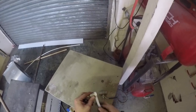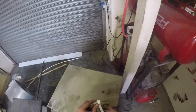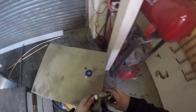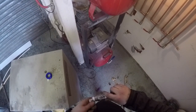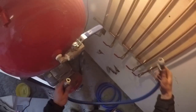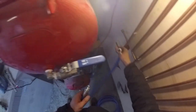Pre-fit and have a think about it before you start tightening everything up, because you might find things are upside down or the wrong way around when you put it on the compressor. I'd do about 10 to 15 wraps of PTFE tape on each of the fittings, and I ended up with not one leak at the end. There was one leak but it was actually due to a locally-bought jubilee clip — they were just extra trash and I wouldn't be buying those again. I had some much better pipe clamps with a bolt on the side, visible in my right hand — those are much superior and hold the pipework really strongly.